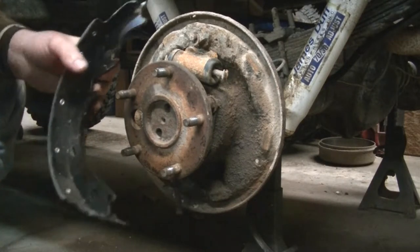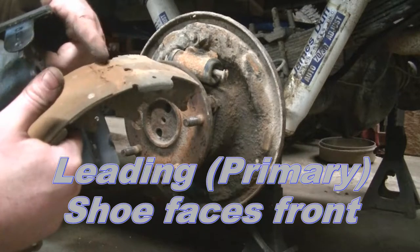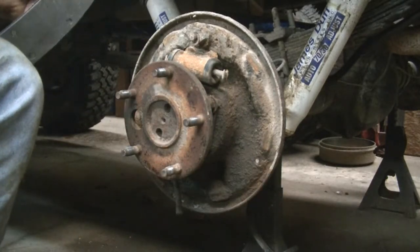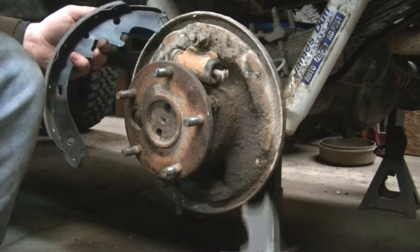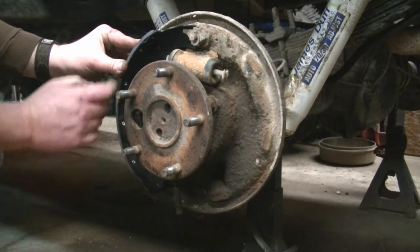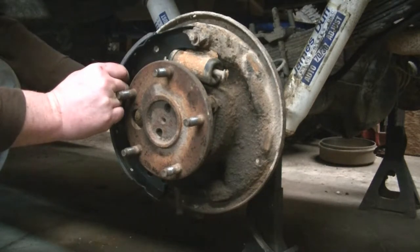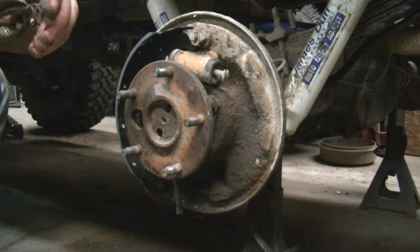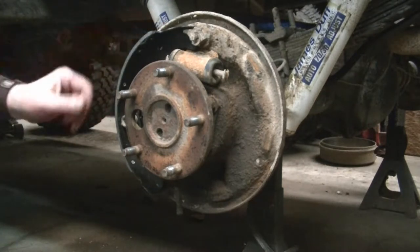I just got back from town with my new brake shoes. I'm going to go ahead and put them on — I'll show you just how easy it is. You're going to want to look on here because some of them have smaller shoes, and those are usually towards the front of the vehicle and the bigger ones in the back. I'm going to put the thinner one towards the front and the thicker one towards the back. You just put it in place, make sure you have the wheel cylinder lined up right. Take your pin, put it through the hole in the backing plate, and put the retainer on. Grab it with the vise grips or regular pliers, push it on, and make sure it's turned 90 degrees from the slots and you're good.